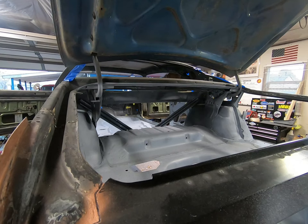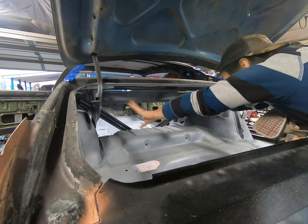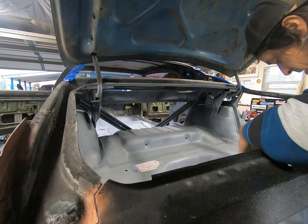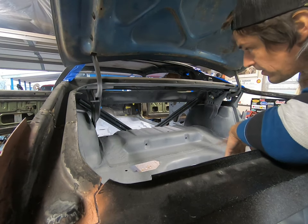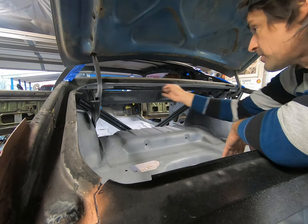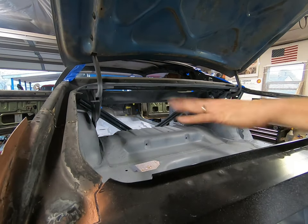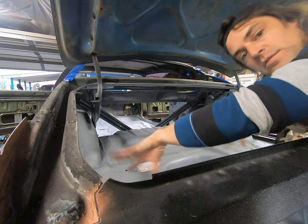So I've got my mask, and I've got this camera set up right here, kind of at the corner above the tail light, and hopefully it's not in my way. I'm going to be up on this little step due to the car being high. I'm trying to get up in there first, all these tight areas, because what we tend to do is spray all the easy stuff first and then try to get in there, and then we bump into the paint. So I'm going to try to reverse think this and hit those V shapes and up in the corners first, and along this edge. Anything inside of here. I'm not going to do the outside of these rails here. That's going to be finish work for later. But I just want to get everything like that, you get it?